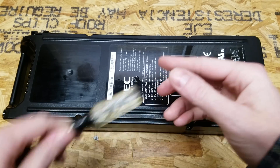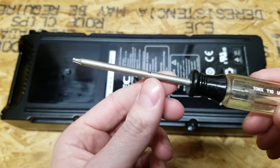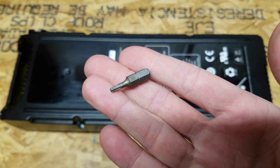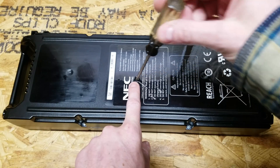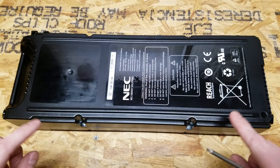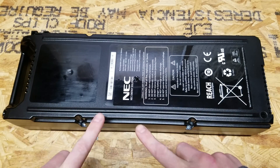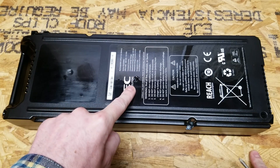To get this battery pack open, you'll need a T10 Torx, and you do need one with a longer shaft. The little Torx bits will not work because there's one long bolt that requires about 2 or 3 inches of reach, and there are two bolts on the side by the handle that go in quite a bit. There are 8 bolts on the top of the case, 4 across one side, and 3 on the other side in addition to one in the middle.